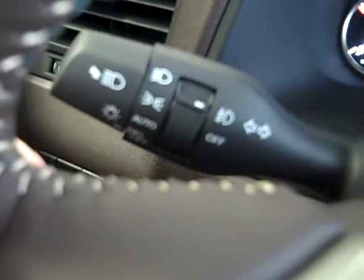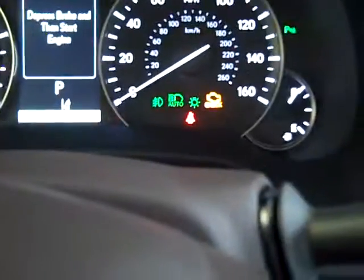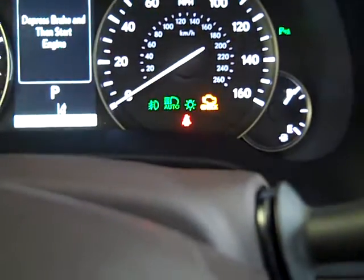Again, you have auto brights. To make that work, you're going to turn on your auto lights, press forward for the brights — which is that blue light — and then press auto. When you do so, you're going to see that auto is shown down here, off of the speedometer.